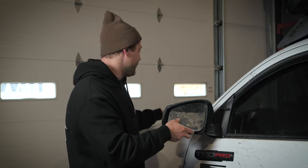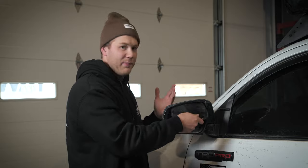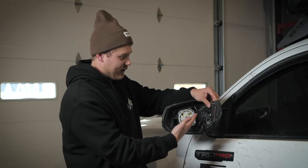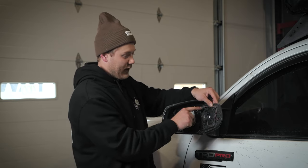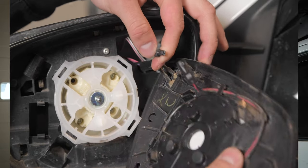It's going to feel like you are breaking it, but you are not. You'll have to put a little bit of elbow grease in there to pop it out, but it is quite simple. This then exposes the mirror. If you have blind spot indicators, the only thing you do is unplug right here — if you do not have those, you don't need to worry about that step.